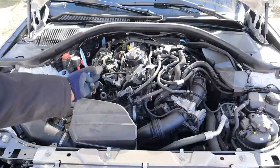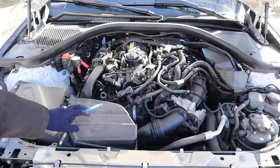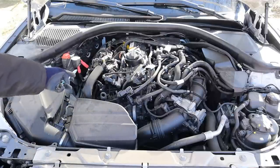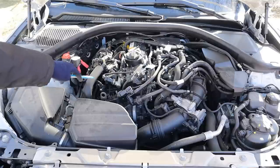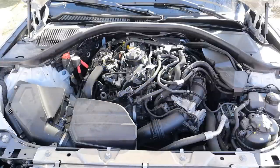You can see the engine is slightly slanted off to the passenger side. The air begins its journey from the air filter box to the resonator and then straight down into the turbocharger, which is on the exhaust side of the engine. There's no intercooler, so that air goes straight to the throttle body and then into the air intake plenum and into the engine to get burned.